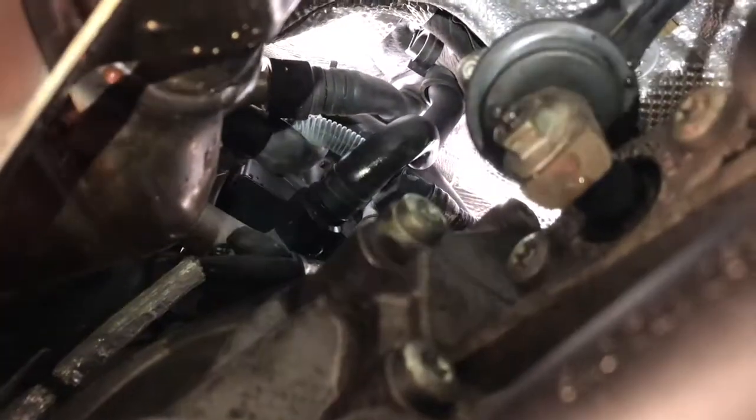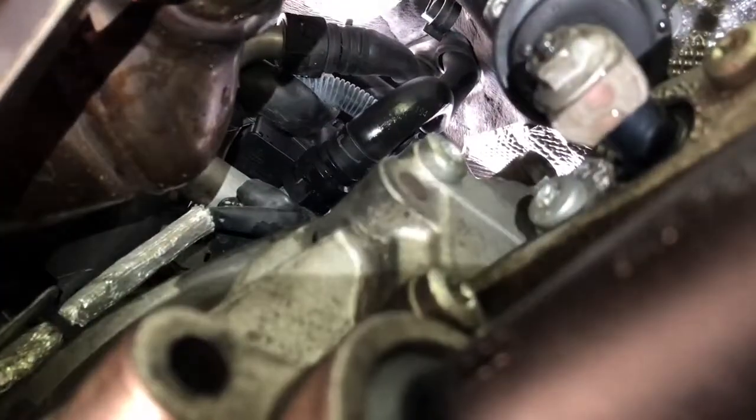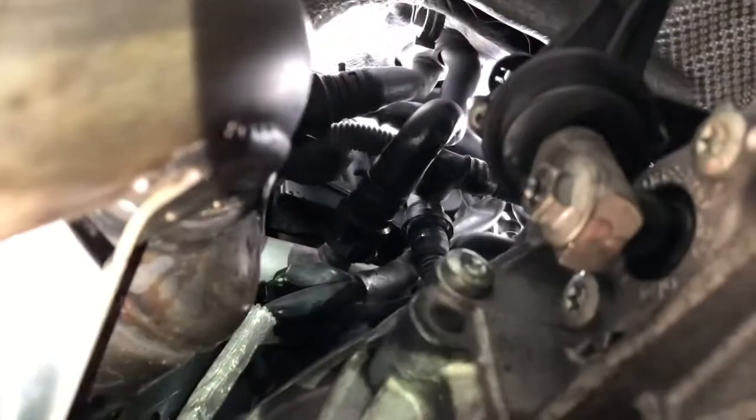The other way to do this is to lower the transmission all the way — I didn't want to do that. Unless you want to remove your transmission entirely, in which case it would be easy to just pop off the cats. Otherwise you have to lower your subframe and transmission as much as possible, disconnect that hose so it doesn't break, and even then getting the cat out is quite the squeeze from here to there.